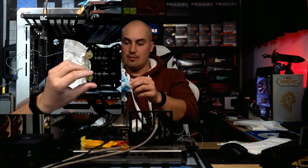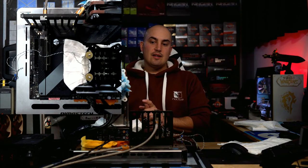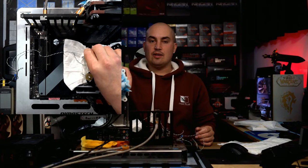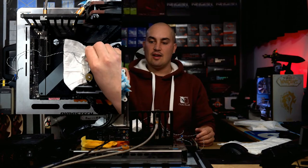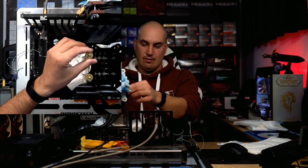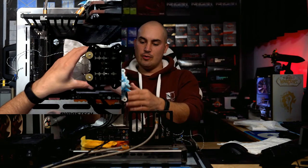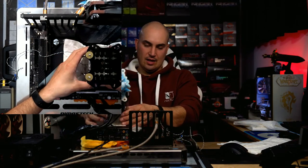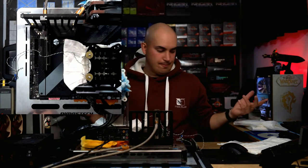So when I find the maximum FCLK frequency, I have to tune the memory. If we are in the range of like 1600, I can go CL10, so CAS 10, up to, I think, 1700, something like this. And if we are super, super lucky and can have like 1700, 1800, something like this, we have to go to CL11. But the primary timings are not my main concern, since when you go very low with the sub timings, this is the key. Then I can mess with the primaries, but the most important is the FCLK.